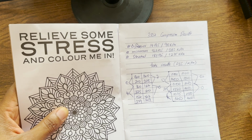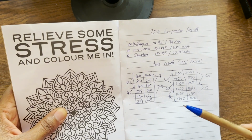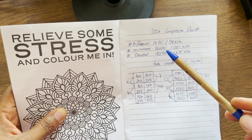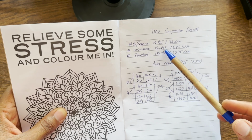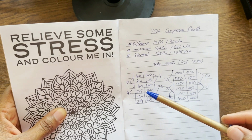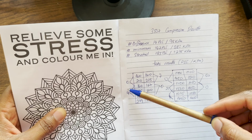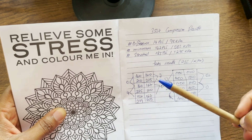Much later. Good news, folks. So we managed to finish up our results, and as I told you initially, we were looking to see if we were reaching the minimum amount of pressure inside the cylinder, which was 142 psi. As you can see right here on the left table, I have the testing results. You can see that across all cylinders, the difference on adjacent cylinders was 4 and 7 psi on each bank, and 0 and 0.